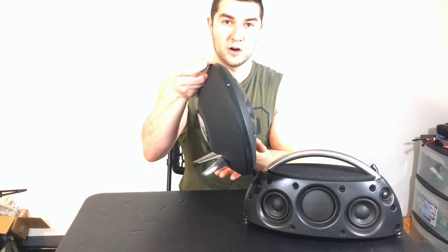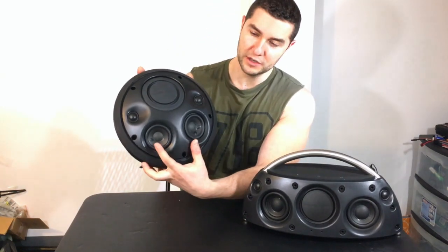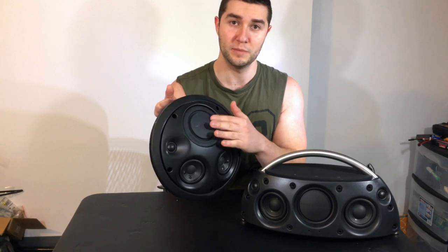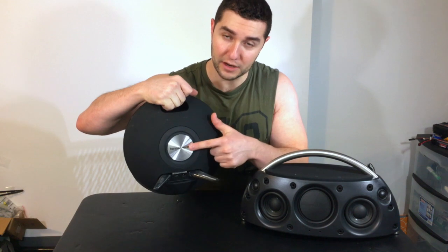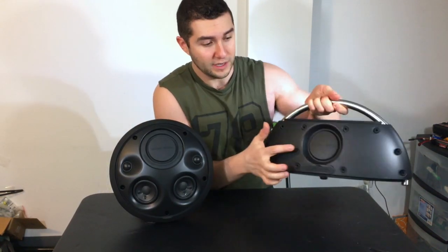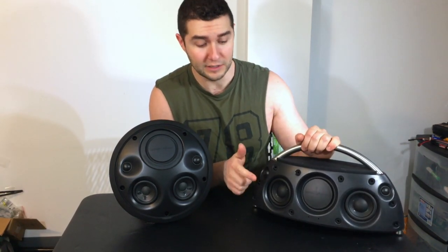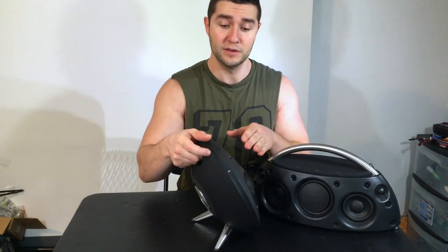This is a normal functioning Harman Kardon Onyx Studio speaker. You have two regular speakers here and two tweeters on top, but the main thing that develops the bass on these speakers are actually the passive radiators. Passive radiators are in both the front and the back. The same thing on this speaker — you have a passive radiator in the front and one in the back. Now the issue is, if the speaker is not sealed and there's a gap somewhere in the enclosure, you will not have the effect of a sealed unit.